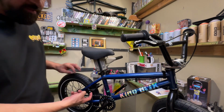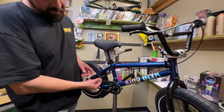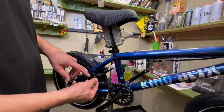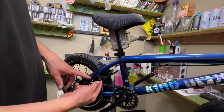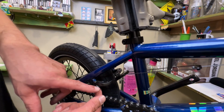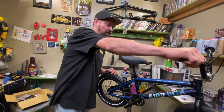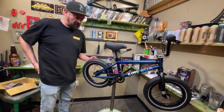The reason why we had to hold this bolt and loosen this one is because we released some of the tension on the spring to make this pad go inward, and we held that Allen head to keep it tight so that it doesn't change the tension of the spring. So on the left side, if you loosen the bolt or this nut, it pushes the brake pads in that way. If you want to know more about that, check out some of my other videos about how to adjust 990 brakes, and that will definitely help you out.